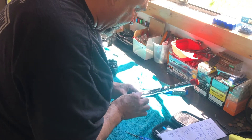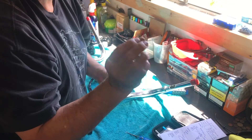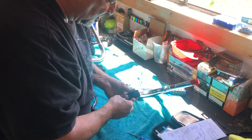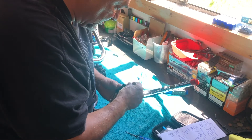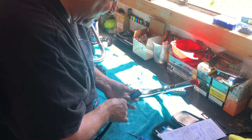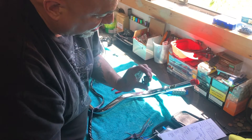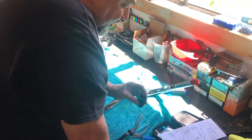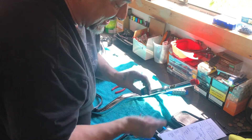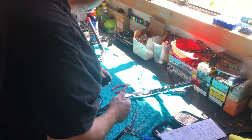Now I'm going to the other side here. You can see this is really small — it's actually one of the smallest Allen wrenches I had and I just filed it down. It's better to make your own tools if you can, though I'm sure companies make the actual tools too. Look, I got the whole thing off already. I'm going to stick this through the back — you want to leave this forward. When you start putting the pins back in this connector, they actually lock. It's easier to push them in. After you put these in, you get a flat screwdriver and push that down, which locks the pins back in. Otherwise, if you leave it out, you won't be able to plug it in.